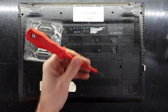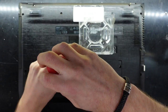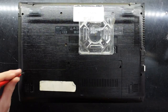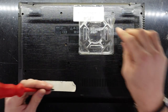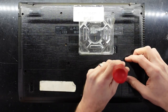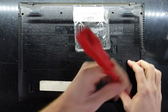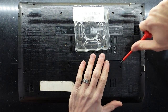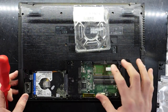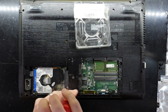To do that we're gonna need a Phillips head screwdriver and basically proceed to take out all these screws. To begin with, if we're lucky they're all going to be the same size. If we're unlucky there may be some variation. Start off here and this should pop out — there we go. As you can see, if you need to upgrade the hard drive or the RAM you can do that from here, but if you want to dig deeper you'll have to keep going.